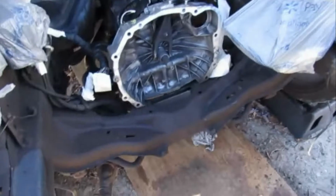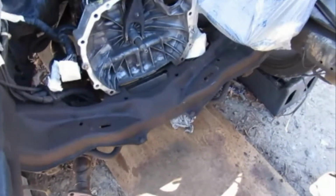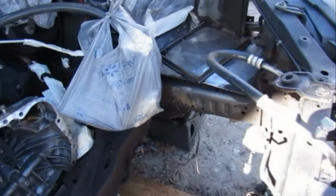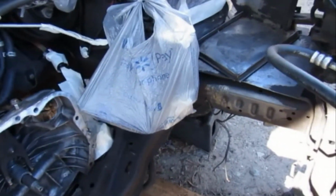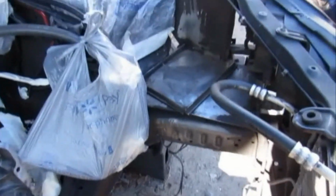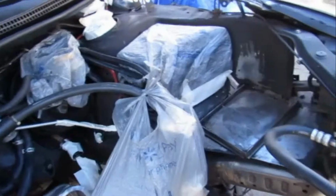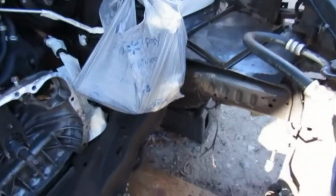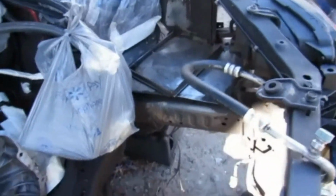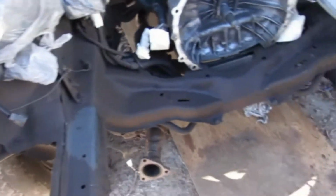I had a couple problem spots, so I went back and ground it off and cleaned it down a little more with some astringent, some 90% isopropyl that'll break down any oils that were left behind, because I think that was why I had the issue. But everything's cleaned up, masked off, and we're gonna go ahead and put the second coat of paint.